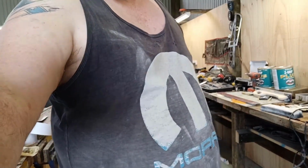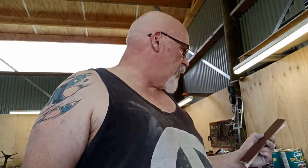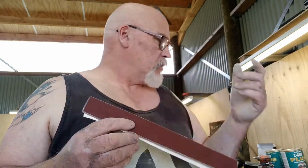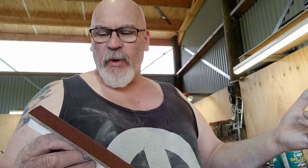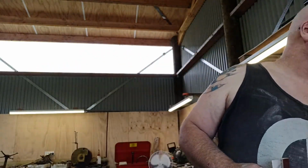Alrighty guys. I didn't even think about it the other day, and somebody suggested get a heat gun and see what happens with the paper, because every time I pulled the paper off, it would leave all the crap behind. I just changed this piece, heated up the heat gun for a few seconds, ran along it until it's warm, and it pulled straight off. So keep your heat gun handy. It worked perfectly.